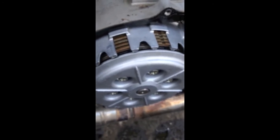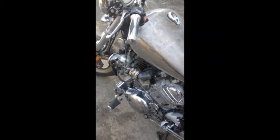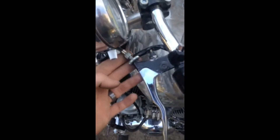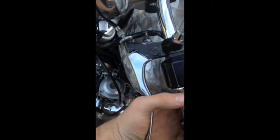Alright, this could be part of it. With the clutch all the way in like that and the handlebar turned all the way in, this screw now has so much pressure on it that I can barely get it to turn at all. So perhaps once I adjust this we will be doing okay. Adjustment has been done — this is where I like my clutch. I've got long fingers.